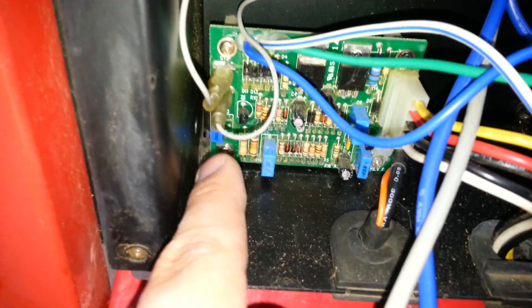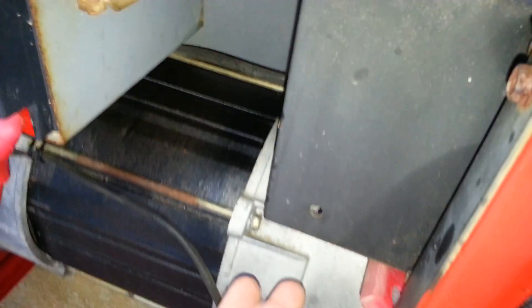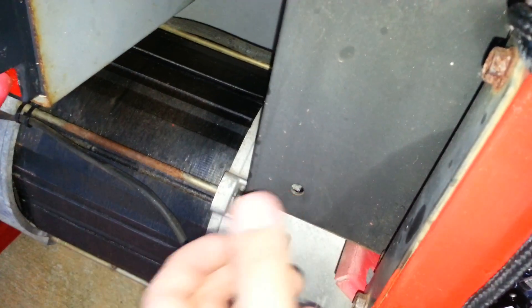Here's how it's oriented — there's a little hole right here on the side. This is your voltage adjustment pot, located right there. Normally there's a little rubber grommet to cover it so it's weatherproof, but mine didn't come with it so I just keep a piece of electrical tape over it. This is where you adjust your voltage when the engine is running.